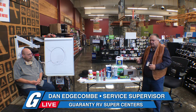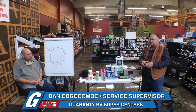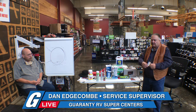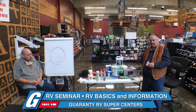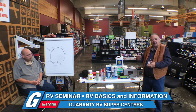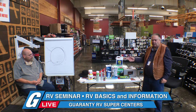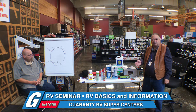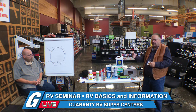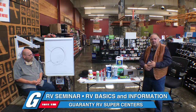If you have a diesel pusher, we're starting to see 15,000 miles between oil changes be quite common — it used to be 10,000. Depending on the bigger engines, they have 35 to 45 quarts of oil and can go up to 25,000 miles per interval. You have to look at your owner's manual to see when you're due. And it's very important to document your oil change — if something happens to that motor in three or four years and it's still under warranty, they may question whether you've been maintaining it.